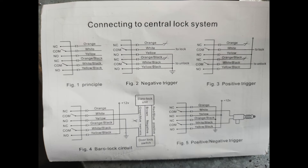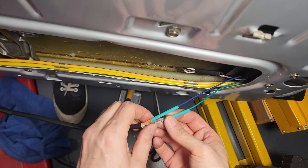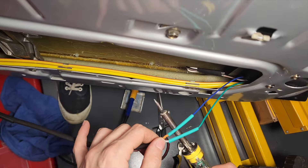Now wiring up the blue and green wire to the remote control unit. It's a very nice neat job - all soldered properly, heat shrunk, and then double heat shrunk. We've secured it alongside the vacuum line so it doesn't get caught by the electric window.